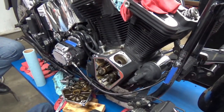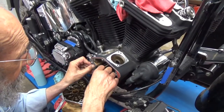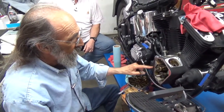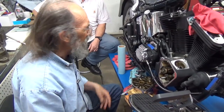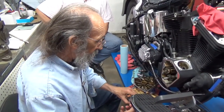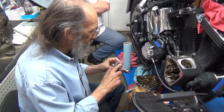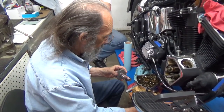And that is the same kind of gasket as I had on this bike in the first place. So I'm going to check the breather, and that just feels perfect to me. What that is is 10 thousandths. With the crush of the gasket you lose 6 thousandths, that would put it at 4 thousandths — it's really going to be at 4 or 5. Factory says 1 to 5, you're really good to go. You just don't want a huge gap in there and you don't want it to be tight and bind. So anyway, we're going to put some assembly lube on these lobes, and we'll probably put a little on the gear.